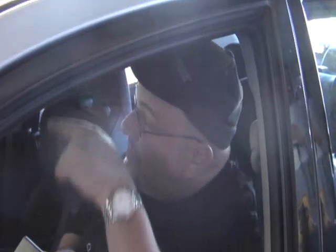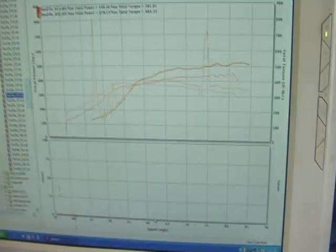That was at about 29 pounds of boost and I'm starting to have a little bit of knock counts. This pump gas with this turbo is capable of squeezing 450, but it's not comfortable — about 420 to 410 to be more relaxed. How much power were you expecting? Hoping at least 475. Based on ETS's rating of about 535 horsepower for this turbo kit. At what boost? At 30 pounds. At 30 pounds, it made 450.